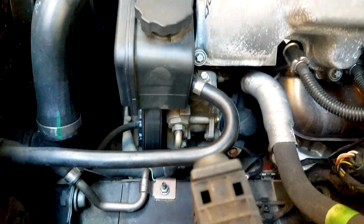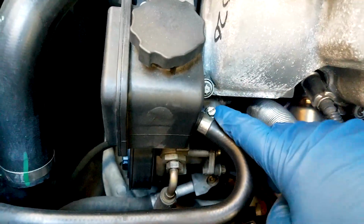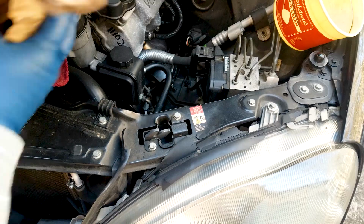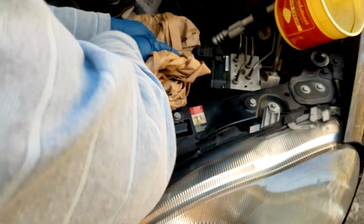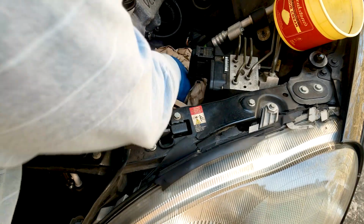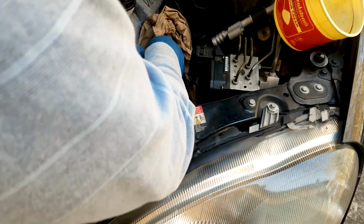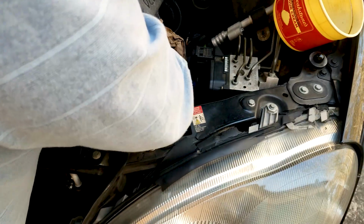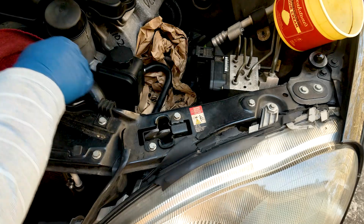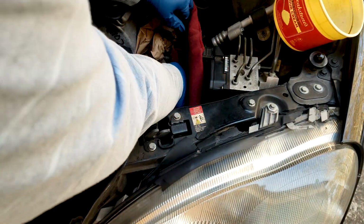You need to remove the driver's side hose, air hose. It's right there, the return line, where the fluid comes out of the tank. And so using a screwdriver, you'll have to undo that. Prior to it, put something underneath to collect any fluid that may come out, and some shop towels, and you'll need a catch container of some sort as you remove the return line to put it under the tank's nipple.